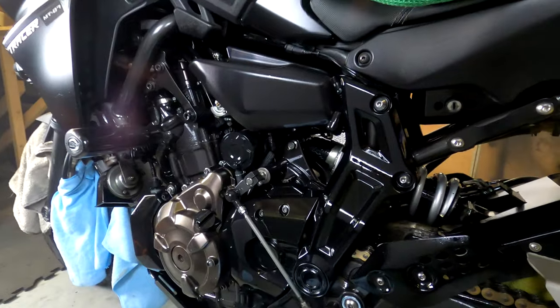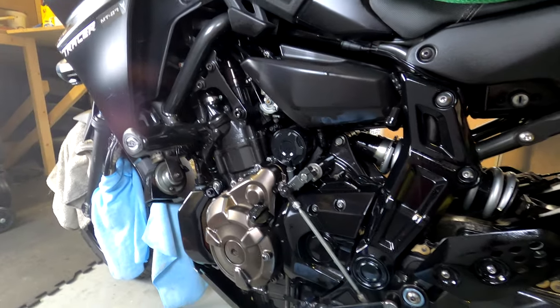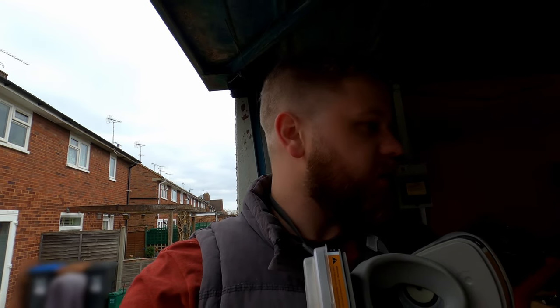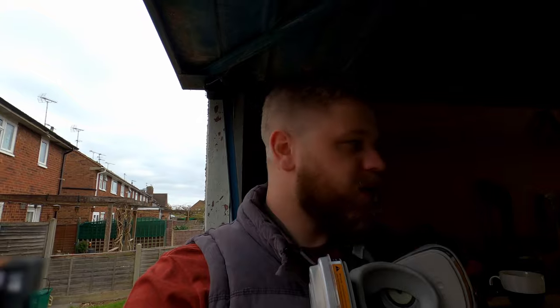You can see a run here as well. With paint it's very difficult to get runs out once they're in, so I'll try a slightly lighter coat on the opposite side and see if that comes out better. I'm just coming out of the garage to let it air out — there's quite a lot of mist in here. That was actually incredibly easy. There were some runs as you'd have seen, but it was incredibly simple to do. I'll let it dry now and let the garage air out. I did have the door open but not fully because the compressor kept cycling. As a quick note from my previous compressor review: it ran the spray gun completely fine, never ran out of pressure. The only issue, being a small tank, is it does keep coming on every couple of minutes.